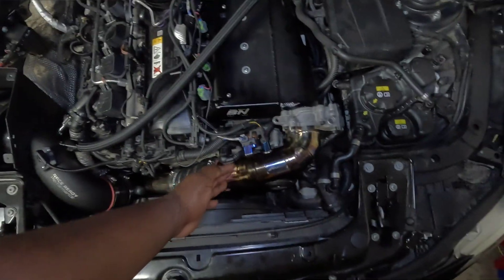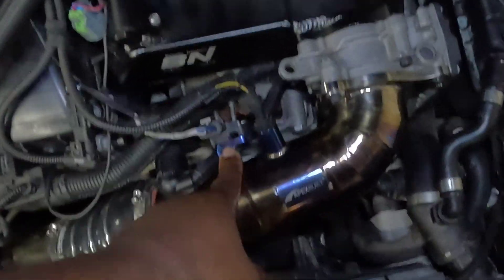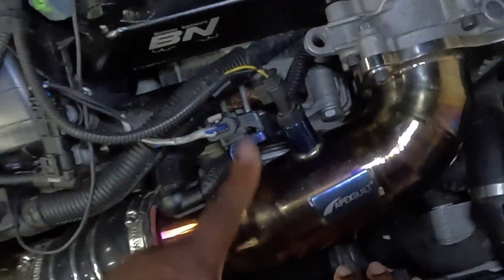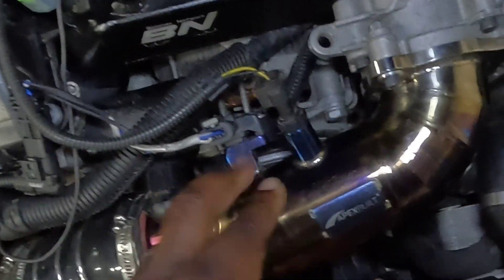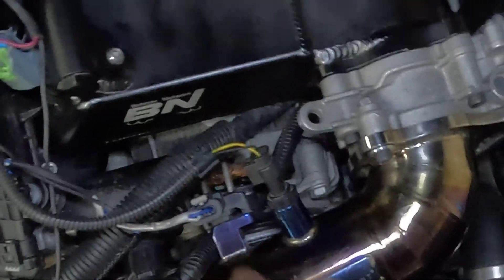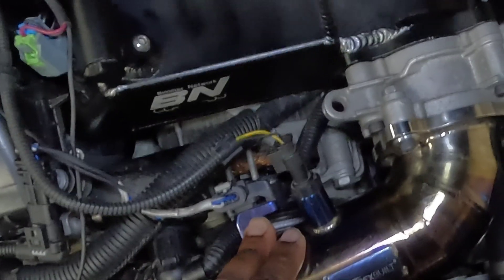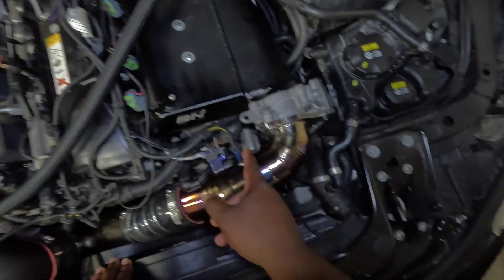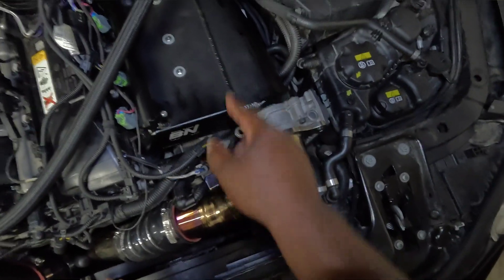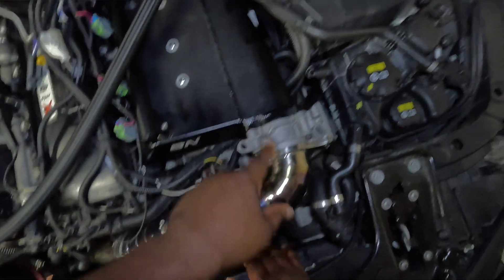After the air comes out of the turbo and up through the charge pipe, we've got two sensors. The first is a pressure sensor measuring boost pressure in the charge pipe — this is a 4-bar sensor that can measure up to around 42 psi, making it ideal for big turbo builds pushing over 30 psi. We also have a temperature sensor measuring the temperature of the boosted air before it enters the intercooler — these are not IATs.